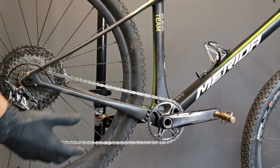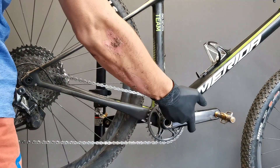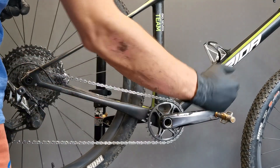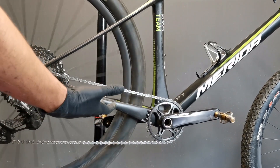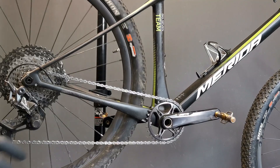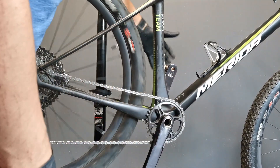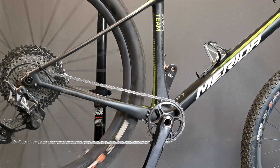If you want to ride the bike, that means your wheels will spin — you will thread the pedals into the crankset in the direction of the spinning wheel. That's it. On the right side, when you are on the drive side of the bike, the wheel spins clockwise. But the same wheel spinning clockwise on this side will appear spinning counterclockwise on the other side. So I'm gonna thread this pedal to the right — clockwise — but this one, being on the other side of the bike, counterclockwise. Always with your spinning wheel.